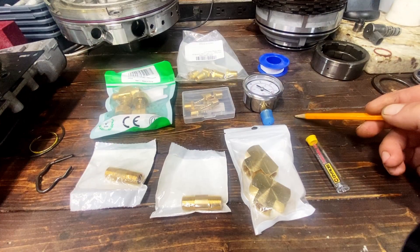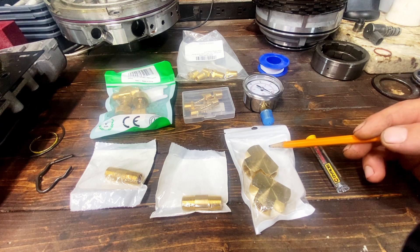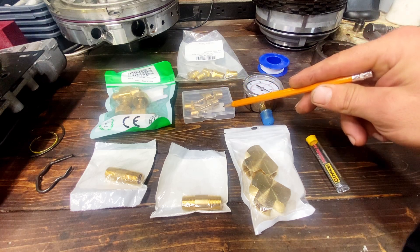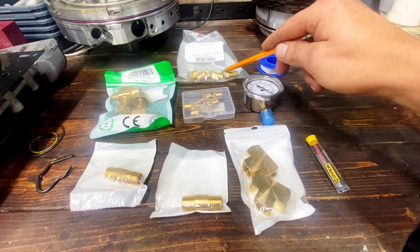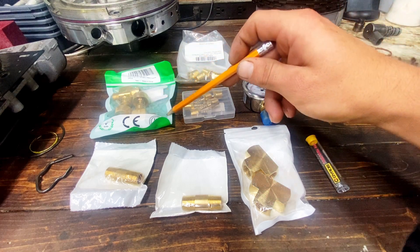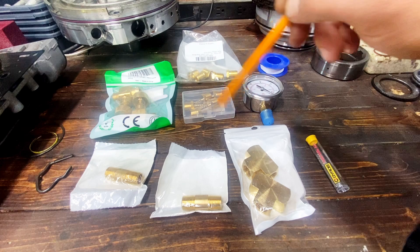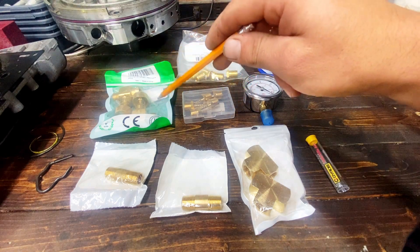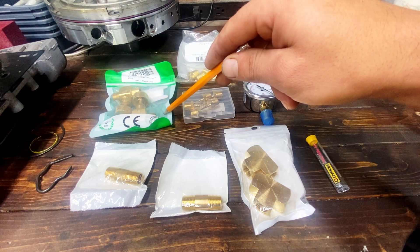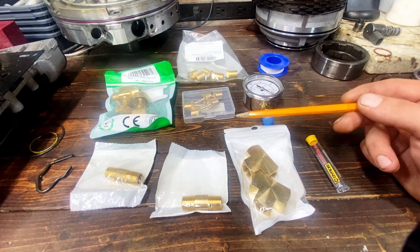So now let's go over what we actually need to build our vacuum tester. We're going to need two brass tees, pipe nipples, a couple hose barbs, end plugs, a vacuum gauge, and needle valves — and they have to be needle valves. This is all quarter-inch MPT, by the way. The reason these have to be needle valves is we need them to calibrate our tester. We do not want to pull a full vacuum on the valve body.